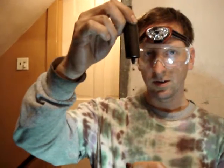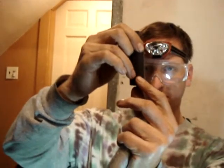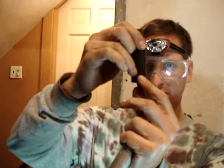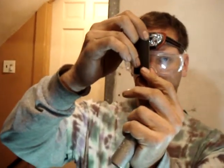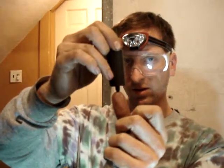So the way this little piece here works is it has a retractable or spring-driven, kind of like a nail. And what happens here is the nail centers the keepers or collets on the center of the valve stem. And the base of this thing actually goes like this, forces those keepers to go down into the spacer. And when it's pushed down enough, the collets are forced down and the valve stem itself is pushing this center piece back up, and in so doing it forces the keepers to go into the right place.